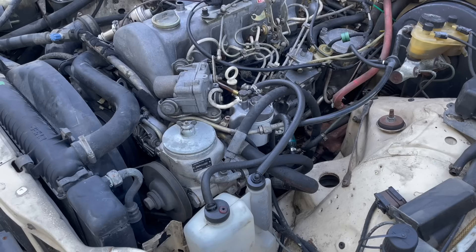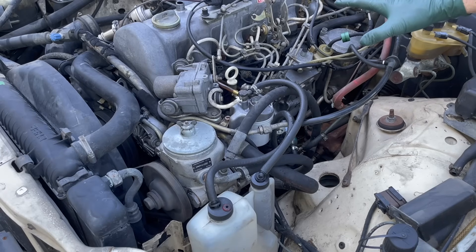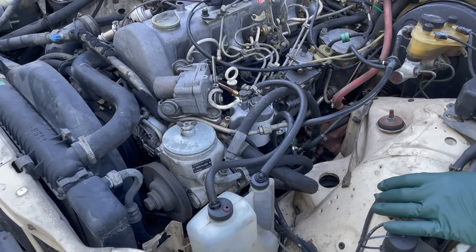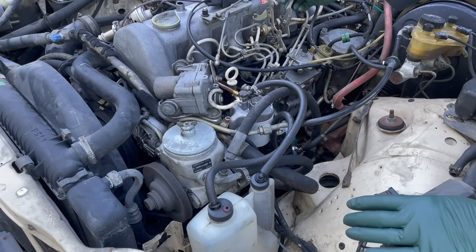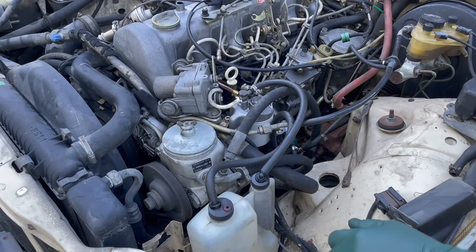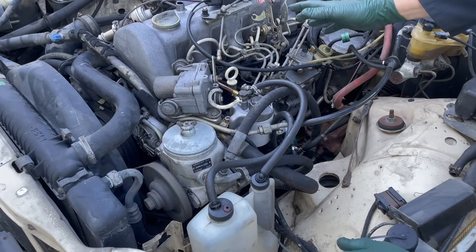Let's go about a minute here. Can you hear the knock I'm talking about? It's a little bit deeper knock than you normally hear. I'm going to put it off idle again. This is normally where fuel injector nailing could go away — but the knock is still there. I've heard this sound before. People drive these things for thousands of miles with funny knocks inside. Doesn't necessarily mean the engine's healthy, but these engines just don't want to die.